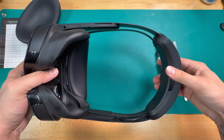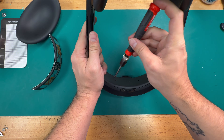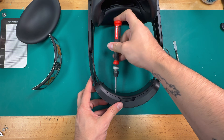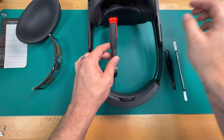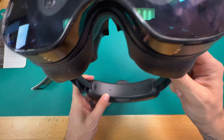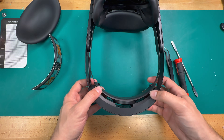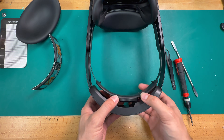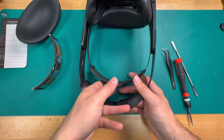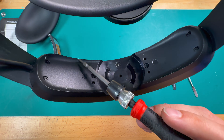I need to extend this headstrap all the way out in order to access the two screws at the bottom. We'll go ahead and take our screwdriver — it's a Phillips double zero bit for these two screws — and pull both of them out. These screws don't actually need to come all the way out, but you'll know when they're loose because this section will become free-floating. Then we can tighten it back up to get it out of our way, and now we have access to five more screws.